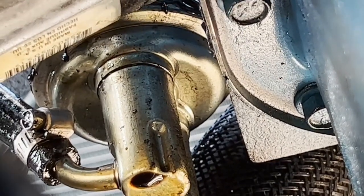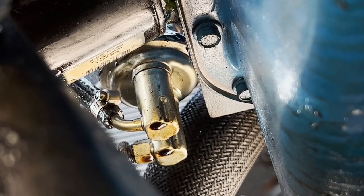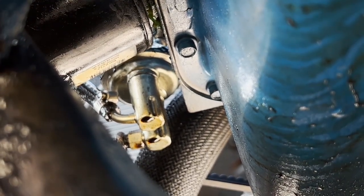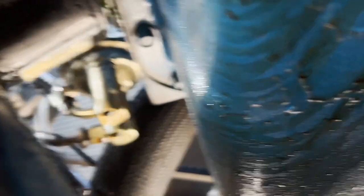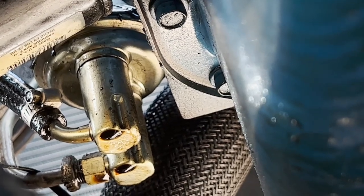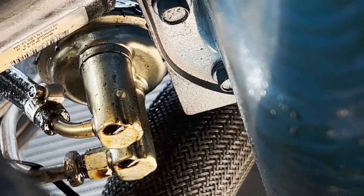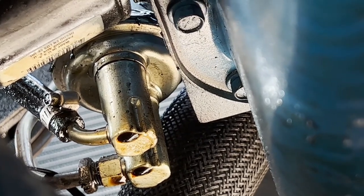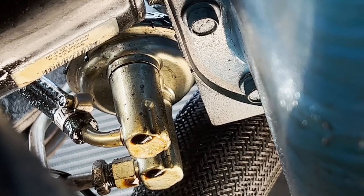Rather than fool around, I'm going to take this one off, get another one, and seal it with JB Weld. This is not the first time I've had a fuel pump do this — it doesn't matter what make or model. It's just due to poor quality control from countries with an el presidente or a chairman-slash-president, if you know what I mean. I'm going to get the new one, clean it up, scuff it up at all those areas — the top and bottom half and around the two inlet and outlet housings — then JB weld it and replace it.